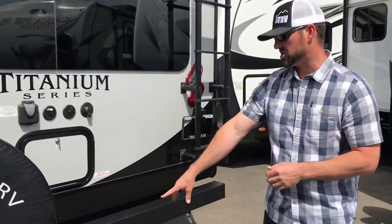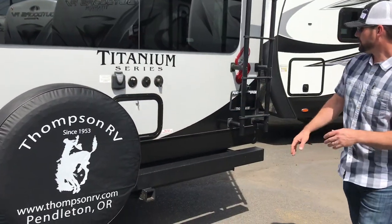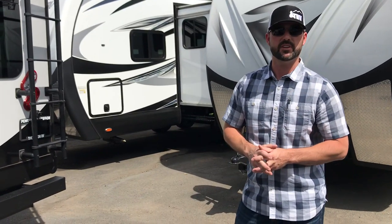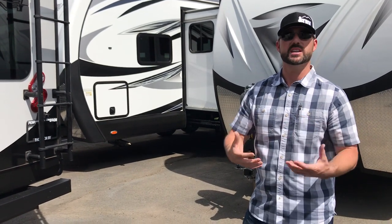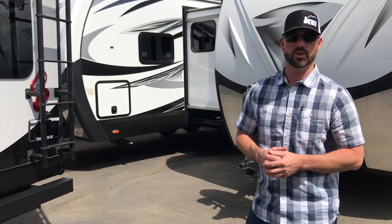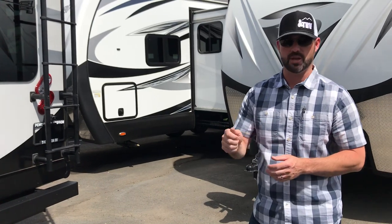We equip these with the mountain storage package, which comes with a 2-inch hitch receiver on the back and a 250-pound total rating. The spare tire is all pumped up to proper pressure and ready to go. All these outdoor RV rigs are a full walk-on roof. Every now and then you just want to check the roof sealant — do preventative maintenance and make sure the trailer stays sealed to prevent any leak before it ever starts. A couple times a year, look around the seams and the vents and make sure that the Dicor rubber seal is staying right where you need it. Just touch up anything that looks questionable.